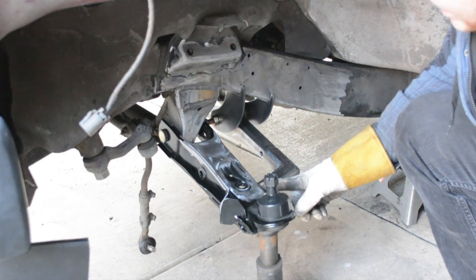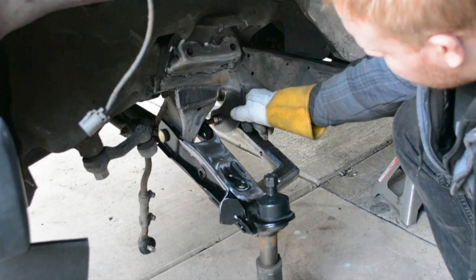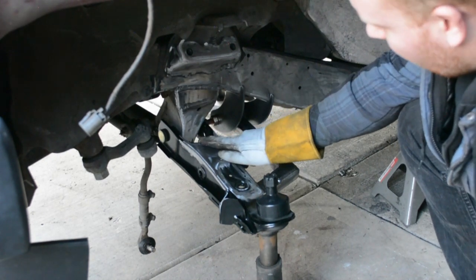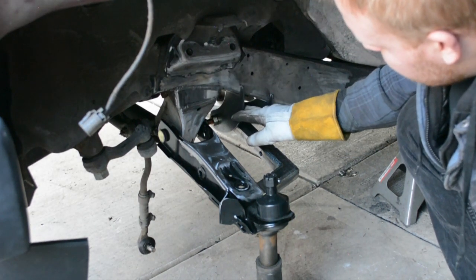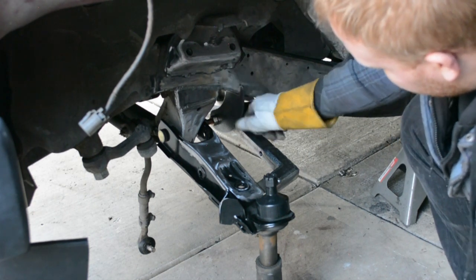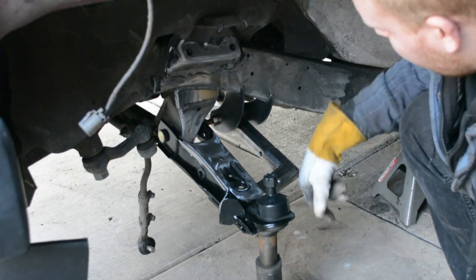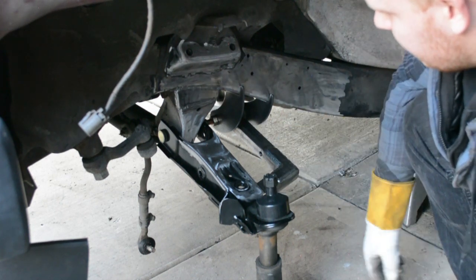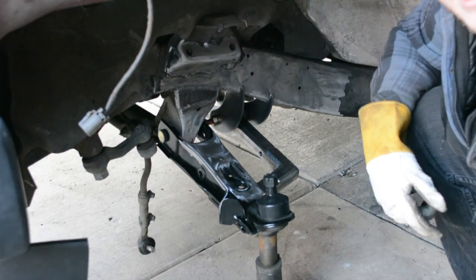Alright, the three lucky winners — I will be sending you a message on YouTube, so be looking for that shortly. Now let's get started with this episode. We got our arm finished last episode, so now we're going to be mounting the tabs that come with the LCA kit — these are the D21-specific ones. We bolted the stock arm on, got that tension tightened down, then put our plates in with a bolt, made sure they're snug so we can push them up to the frame. The control arm is held up by a jack so we can tack the brackets. Once tacked, we keep everything bolted so it stays true, weld it all the way around, let it cool, unbolt, and it's done.